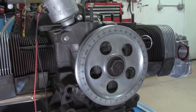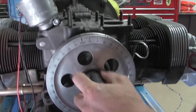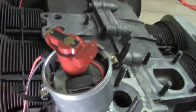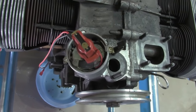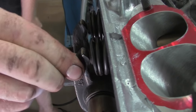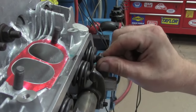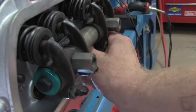We're going to roll it around to where we see top dead center. You never want to trust the distributor because they're put in 180 off all the time — people put in distributors wrong and you can't always trust the rotor. Right now the distributor is pointing at number three. To tell if it's number three and not number one, we come around and find out if the valves themselves are actually loose. On number three, with chromoly you're looking for anywhere between zero and three thousandths lash — and these are loose.